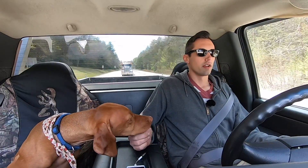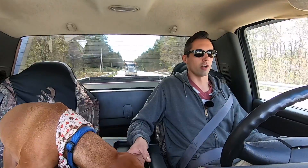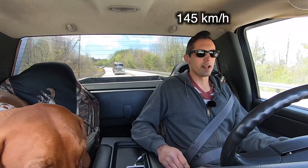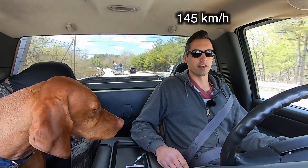It's also not a bad idea because the rear differential actually seems like it could use a rebuild — there's quite a bit of play when I move the drive shaft. That's also convenient because I was planning on installing either a limited slip differential or some kind of locker, because the truck right now has an open differential. If I change the axle ratio to a 3.13, that theoretically limits the top speed of the truck to about 90 miles per hour, and that's certainly faster than I'll be driving it.